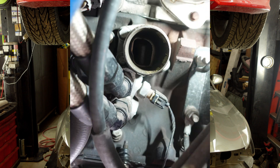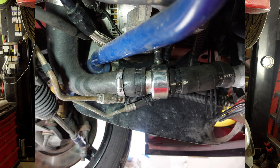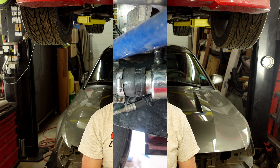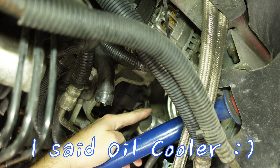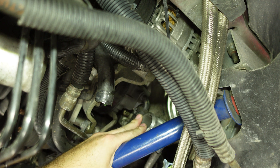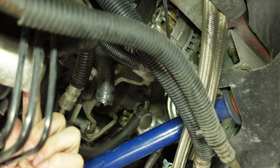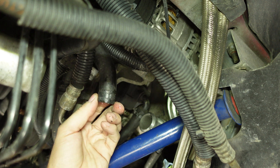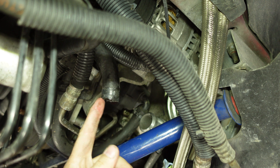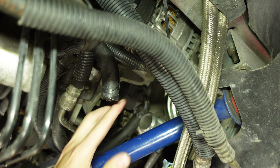Keep in mind, I already had an oil cooler delete on my car - the Ford Racing piece - so I removed that. I had a lower T I made many years ago, almost a decade ago probably. I got all that out of there. Right here - I couldn't get a great camera angle, but you can see there's a stock intercooler installed. Here's the lower radiator hose, or radiator outlet I should say. Normally your thermostat would be sitting here. This hose that's dripping on me is the one that runs up to the bottom of the degas tank. This is three-quarter inch, this is inch and three-quarter, and this is inch and a half - so there's quite a bit of variation there.